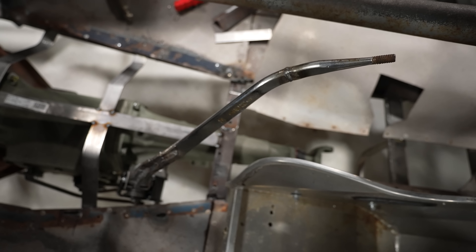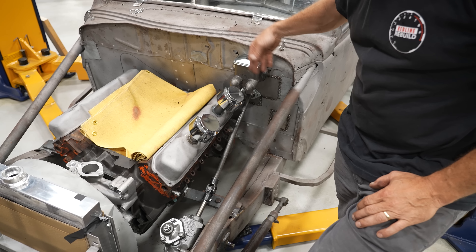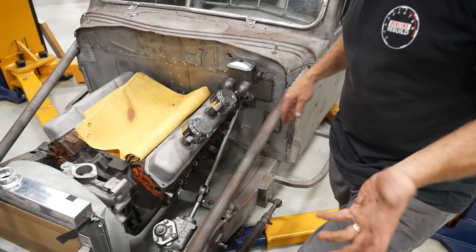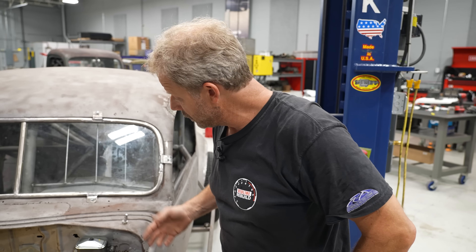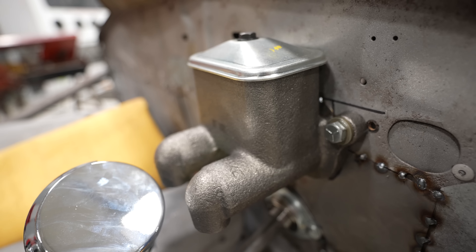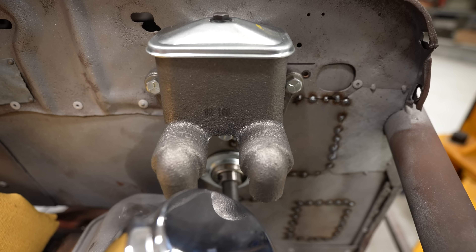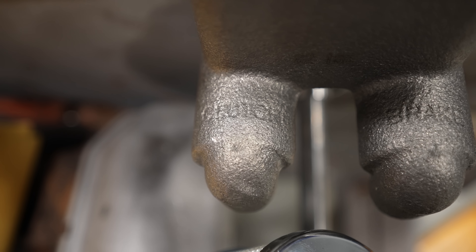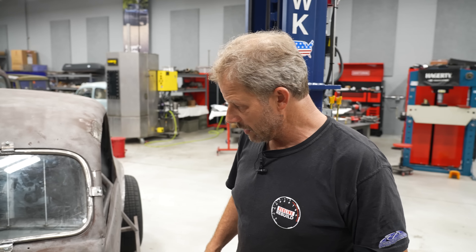One of the dilemmas we got into is overall packaging of our brake and pedal systems. Initially the plan was to have basically two stock master cylinders up here — a dual reservoir for the brakes and a single reservoir for our hydraulic clutch. At the end of the day, they wouldn't package. So we did a 180 with it and pulled this brake-and-clutch master cylinder combo — it's one unit but has two cylinders and one reservoir, labeled brake and clutch. We did a little finagling with the pedal assembly — it's an old hot rodder trick. The pedal assembly is out of a '63 Chevy pickup truck using a hydraulic slave cylinder, so now everything is packaged nicely in the tight spot and should work very well.